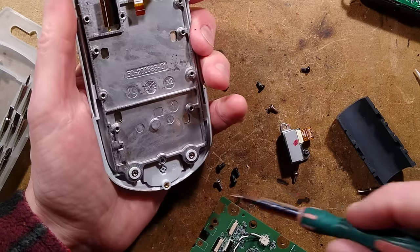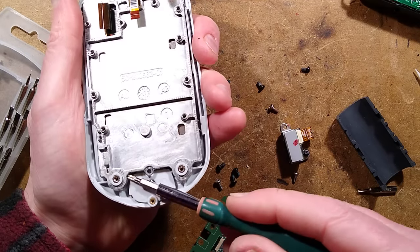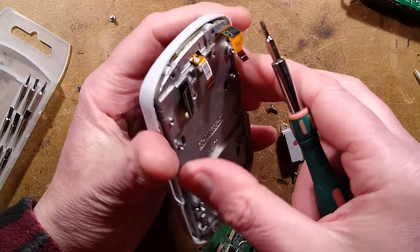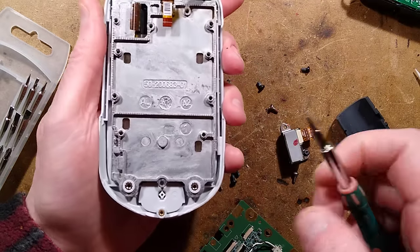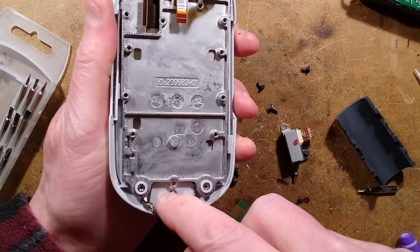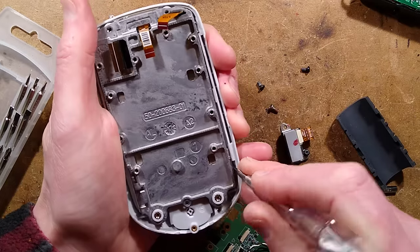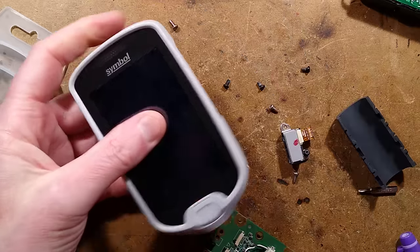Are we more or less clear now? No, there's one more. I shall carefully push that forward - the one that pushes forward, without using excessive force. You'll all have terrible memories of the first time you opened one of your phones and all the little ribbon cables burst because you didn't know how to take them off. There is an art to it. That is more or less it - do we go further? We do go further. I've got some screws here. I don't think this is going to come off without breaking stuff - I think it's held in by clips at the side.